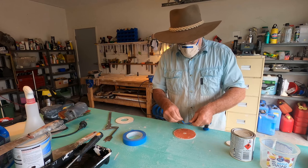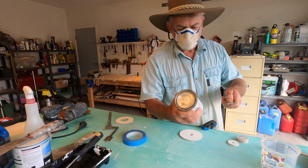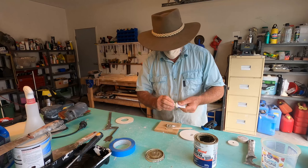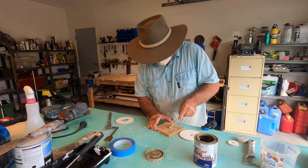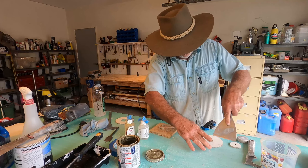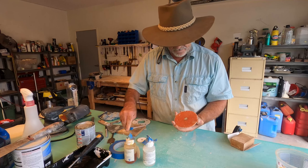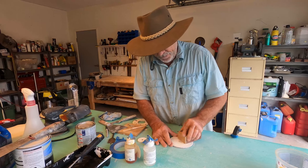In this case I'm repairing from the outside. Usually you can get in through an access port somewhere and put a bit of tape on the inside, but here I'm just using Plastibond. I wipe the surface down with a bit of acetone first. There it is — wait for that to dry. Now the filler's dry and I can remove the backing. On this side I need to sand that back level — I left it a little bit proud.